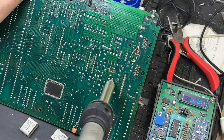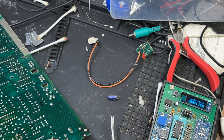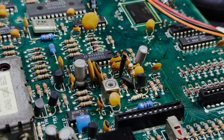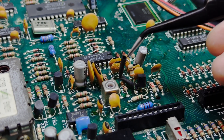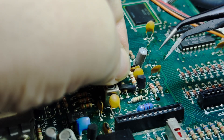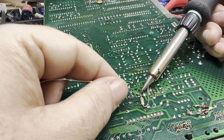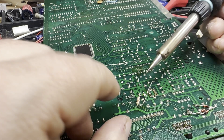To do this mod is actually fairly simple. It just involves removing a set of resistors, changing them for different values, and then adding two extra resistors to the board. The most difficult part is the one that goes between one leg of transistor TR5 and back to the board. The hardest part of this mod is getting that transistor leg out, pointing it up, putting the new resistor leg in there, then attaching the other end of the resistor to the transistor leg you've just pulled out. I've added a little bit of heat shrink to help cover things up and make sure nothing shorts, but there's plenty of room under the case. Finally, one more resistor attaches to the underside of the case — just two points to solder, and that's our modification done.